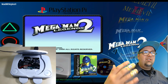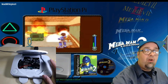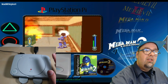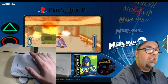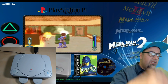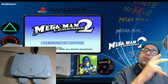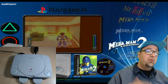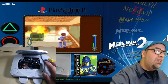Unscrewing the case just uses normal Phillips head screws, so that's very simple. On the original PS1, I believe there's six screws. There's one that's covered by a warranty void label on the backside, so you either just cut out the little hole or pull the sticker off, remove the screw, pull everything out, and then start snipping all the little extra tabs that are in there — making sure you're not snipping the spots for the screws — to fit everything in there snugly.